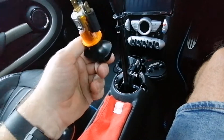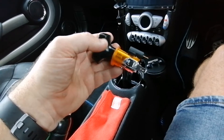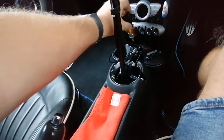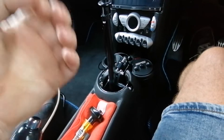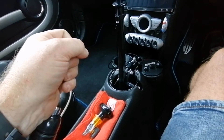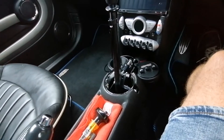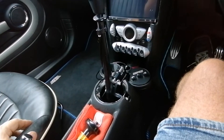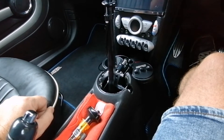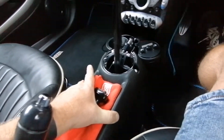The other issue is that Mini puts a piggyback earth on the back of the 12-volt socket, and obviously it won't go through the hole — there's not enough room with the Coolerworks in position to connect that properly. I'm going to have to come back and sort something out for that. I can fish all of the other cables out fine, but the earth doesn't reach — I'll probably have to extend it a little.